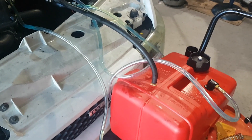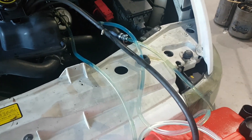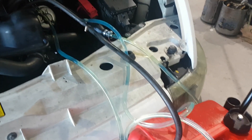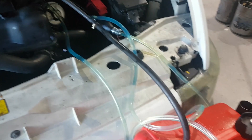I'll get you a shot of it running on this fuel supply. Much, much better — basically no air in the system now. If I rev the car, it revs fine. I'm sure if I was to take it for a test drive it would probably have no symptoms at all. So I know I'm in the right direction — we need to head back towards the tank because we've got a restriction. No air in the system.